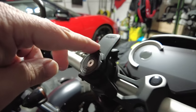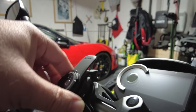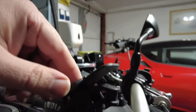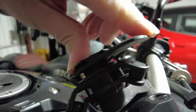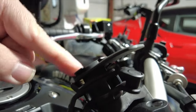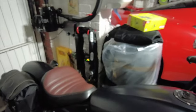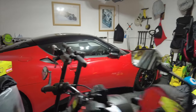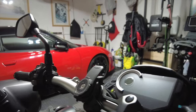This is my Honda CB1000R. You can see here is the Quad Lock that I have on here, and you can see it's got this little triangular thing around the side — that basically is the vibration dampener. Coming around the other side you can see it a little bit better; it's basically got some rubber bushing in there so as things move around the vibration is dampened. So it still fits in the same way — the vibration piece is basically just removing the top piece, adding the vibration dampener in there. We can have a look over on the Indian to see how it looks right now without it.